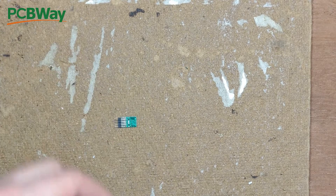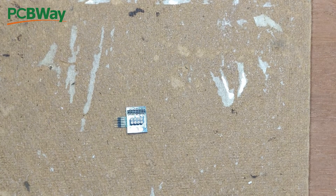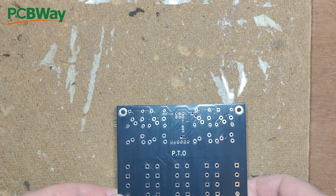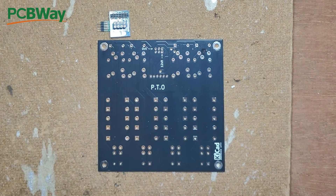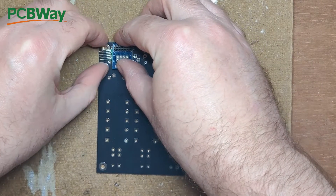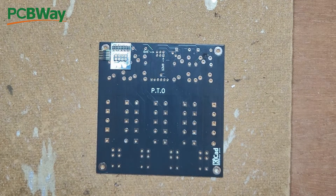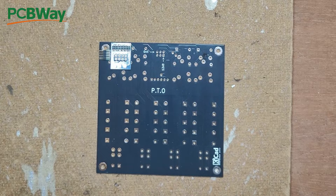The adapter would need to be a small PCB with 6 pins on one end like a 6-pin decoder has, but with an 8-pin socket through the side to connect an 8-pin decoder into. It would have to have two additional solder tabs to expose the two further pins — the power pole on pin 7 and the third function from pin 3. The downside is you'd probably end up with loads of the little PCBs, as the cost-efficient small production size is five boards of 100mm by 100mm square, and you can tile a lot of these tiny adapter PCBs into that space.